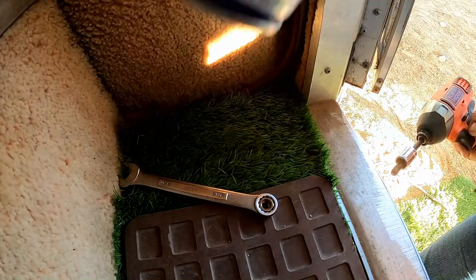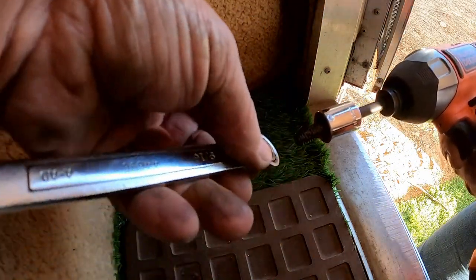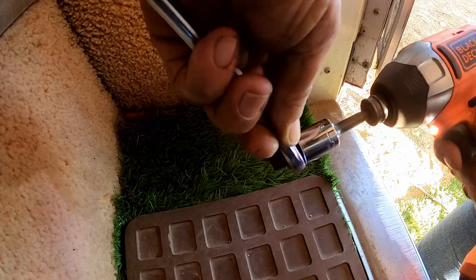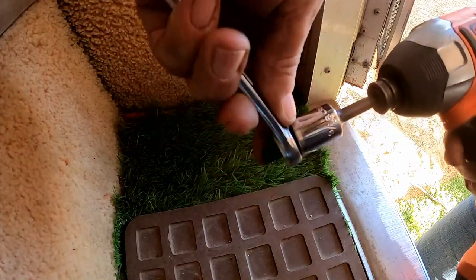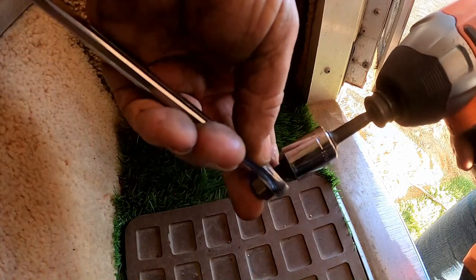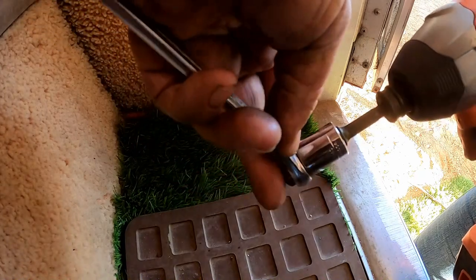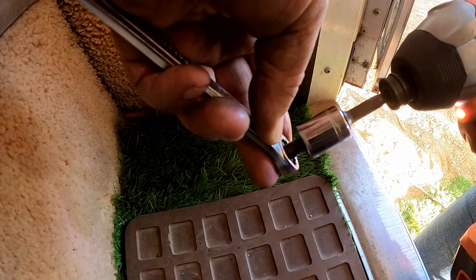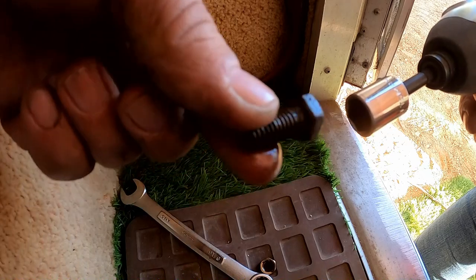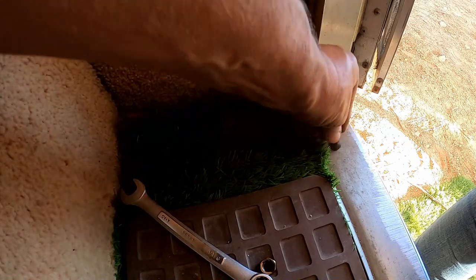Don't need much. We'll just get a little squirt. I'm going to put it in this nut here. Give it a little. Oh boy, she's good. All right. Oh, a little bit tight halfway up. Oh boy, she spun right off. Sometimes it doesn't take much. Well, we had it half cleaned out anyway. But it went perfectly fine the second time. All right, that could be acceptable. I'm happy that those threads are 98% functional again.